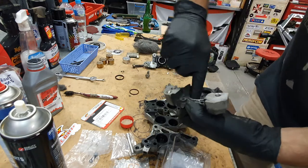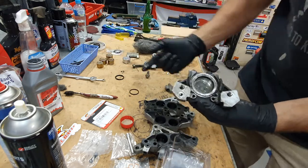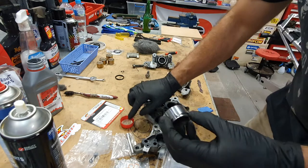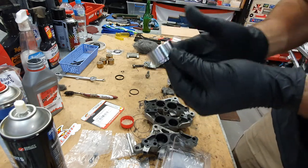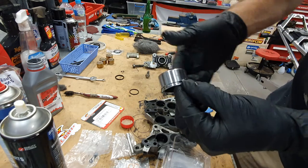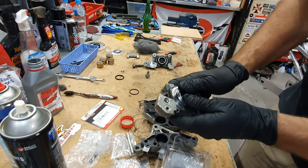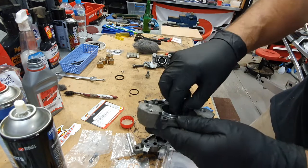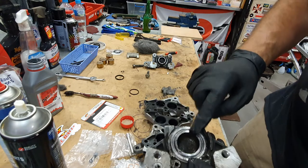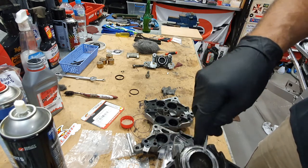Having your gloves makes a massive difference. Basically lubricate the bore with brake fluid — since brake fluid will be inside anyway, it works perfectly. Grab the piston and do the same. I gave these a good clean; there are a couple of marks but no indents when you run your fingers over it, so it'll run over that seal really smoothly. Line it up and work it in nice and evenly. Push it in — that's done. Be careful not to push it in too far. If that happens, grab a flathead screwdriver and bring it up just a tiny bit, very carefully, so you don't snap that lip.